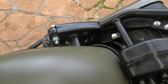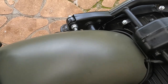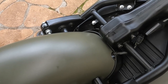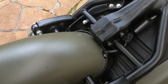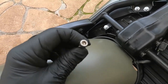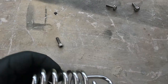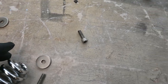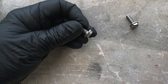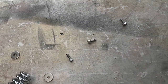What I found when I tried it was that it was very difficult to do, and I wanted to fit it without removing the rear mudguard — which is a fair bit of work to take off and, more importantly, get back on. You don't know once you feel around with mudguards — you could bring it back and find you've picked up added vibration because it wasn't in the same spot. So I decided to fit this one inside the spring section and use the normal bolts into the framework, with an extra washer, which makes the work a lot easier.